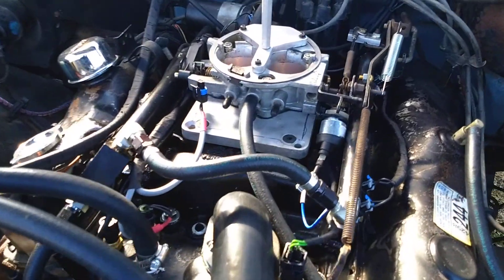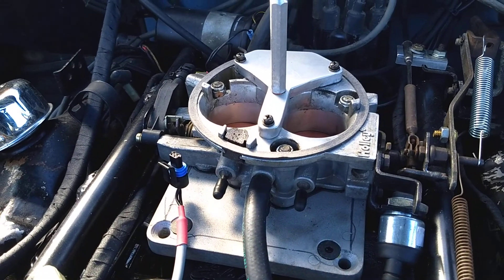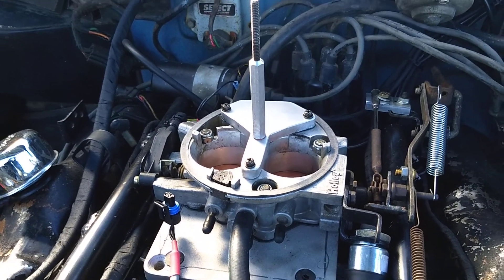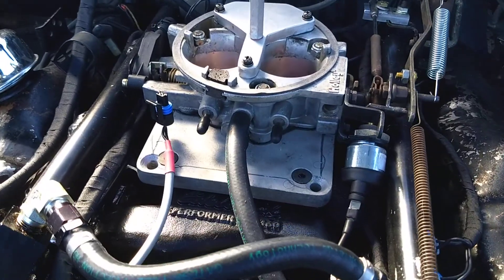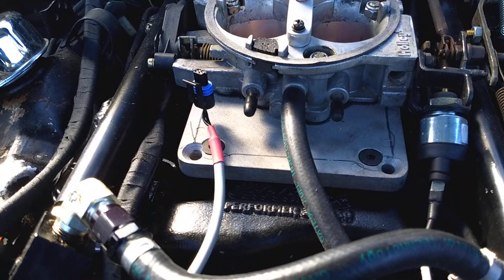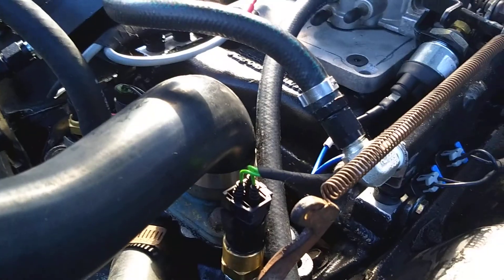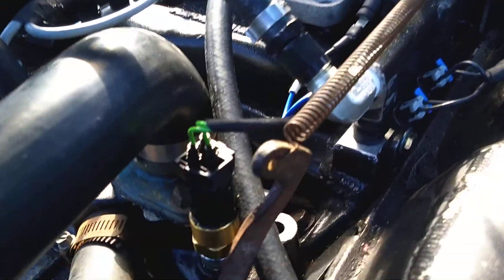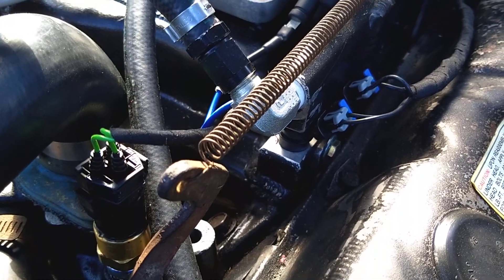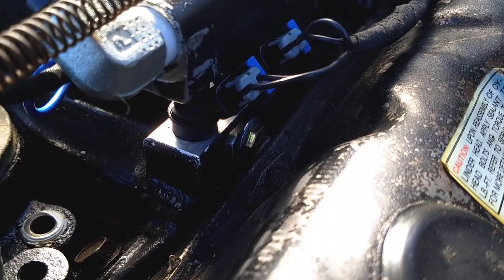You can see in here I've got a Holley TBI unit that I've removed the injectors from. Then I got ahold of a used Edelbrock Performer intake manifold and milled some slots over the intake runners and welded some blocks on there so I could mount my port injectors. I got everything painted black so it's kind of hard to see the stuff.